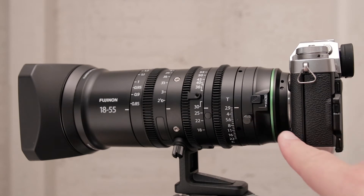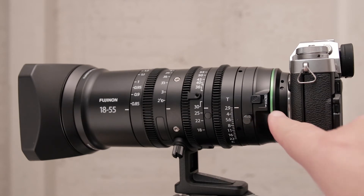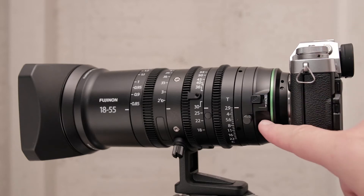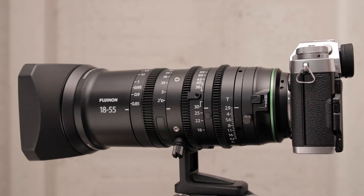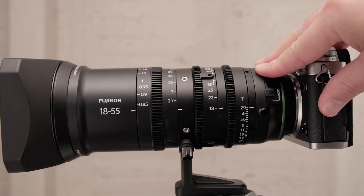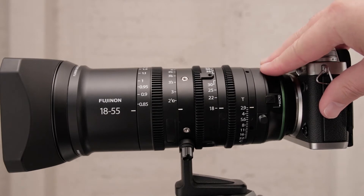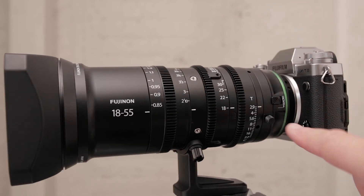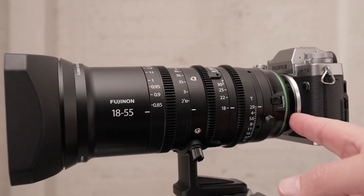Flange focus affects the actual focus function of the lens onto the focal plane, or the sensor plane right there, and if it's out you're going to struggle to focus the lens, especially on any wide-angle settings. The reason we have it is to do slight adjustments to compensate for variations due to temperature, wear and tear, and in some cases even camera mount distances.